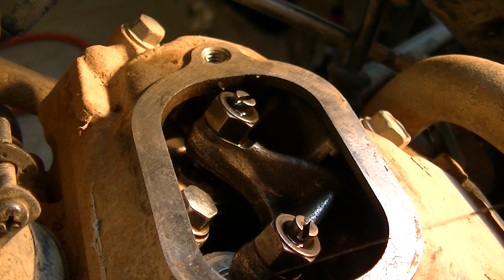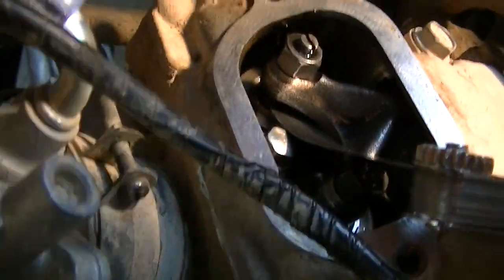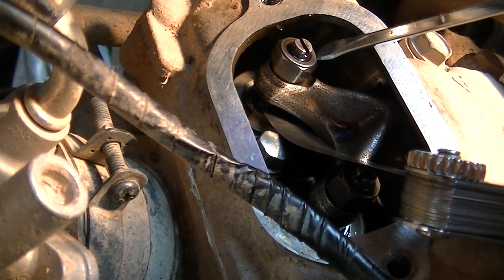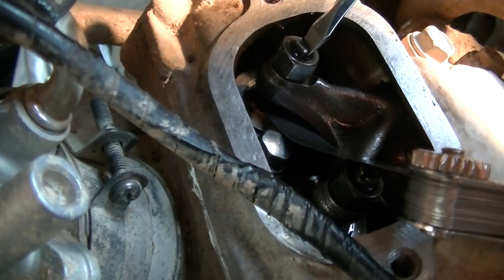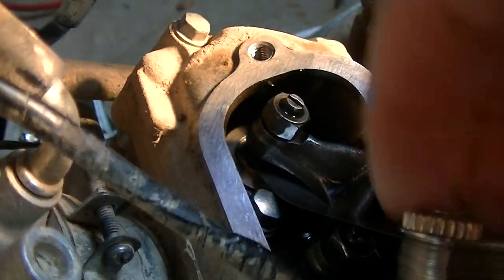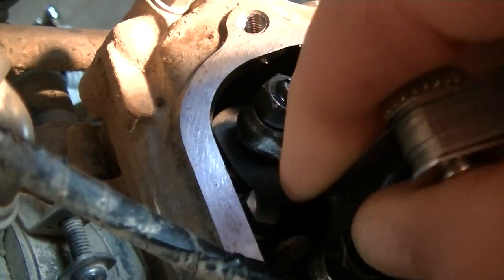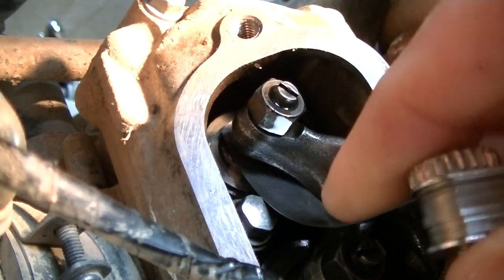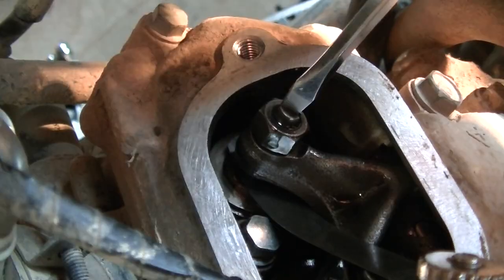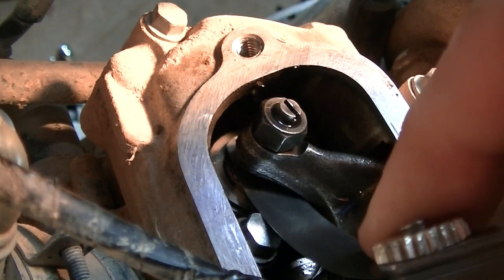What I'm going to use is a 10 millimeter wrench and I'm going to loosen this up right here, both of these. I used my wrench and I loosened this nut here, so that's nice and loose. And I loosened this top screw so I could slide my 5 thousandths feeler gauge up in there. You can see I'm in there. That's too loose, so what you want to do is give this a turn. Now there's resistance on that.